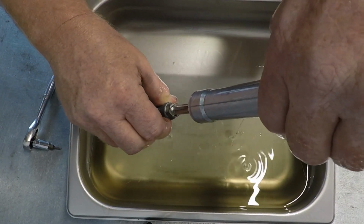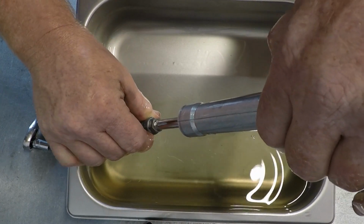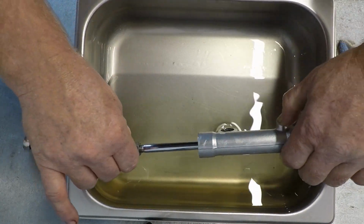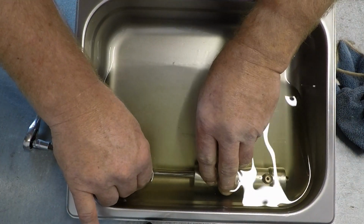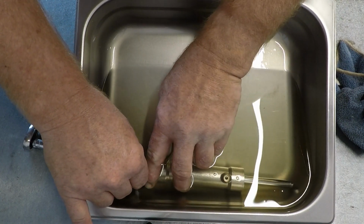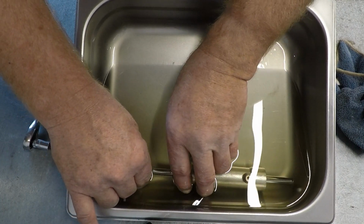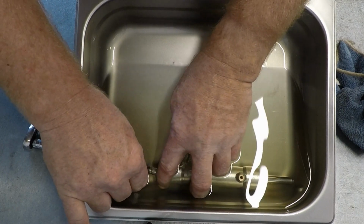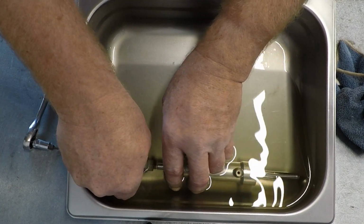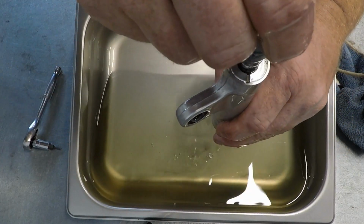That's what I'm doing here, making sure that all the air is moved around past the piston. Make sure that there are no air voids in there. When I put it back in after doing this, you'll see what I mean. So if you watch, somewhere here, there's one. Every single bubble will feel like a notch or a clunk in the damper as you bleed it through. Any time you see oil spurt, that's air being moved around inside it. So you've just got to keep going backwards and forwards, keep making sure that you get all the air out.